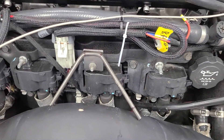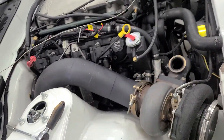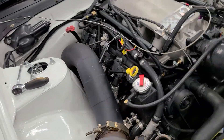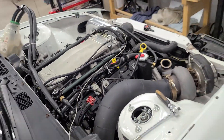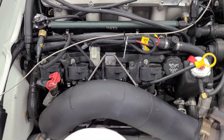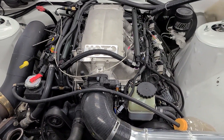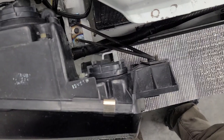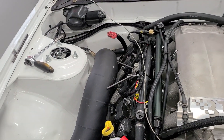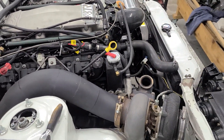This is pretty much what I've come up with. I decided to go ahead and bend that bar and make it out of one piece - it'll be easier to weld and just easier to fabricate all the way around, just look better I think. I just need to fine tune it a little bit, clean all the metal up and then weld it in place. I really like working with round rod to make brackets and things. You see that on a lot of race cars, so it kind of gives it a race car look. Definitely not something you see every day on a street car. You can see my headlight brackets that I tacked up the other day are in place there.